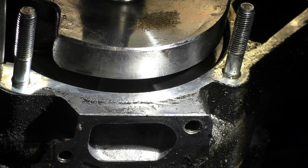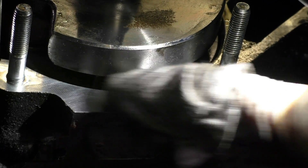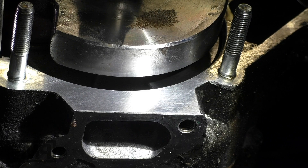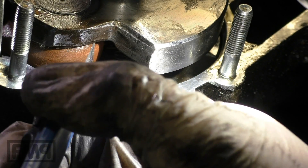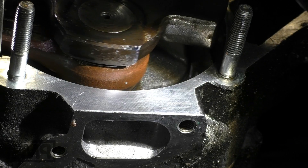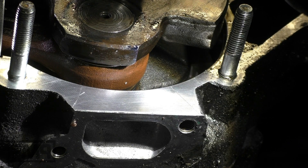We also want to measure the intake timings, so we can mark the engine case where it has to be opened, and to mark the crankshaft where it has to be cut. I usually take a knife, finding out where the intake originally ends — here it closes, it opens here, and this is the end of the rod's valve pad.